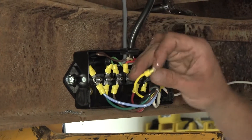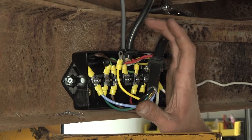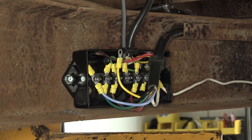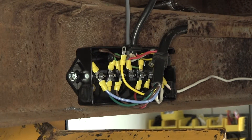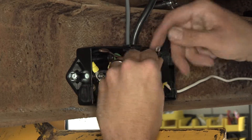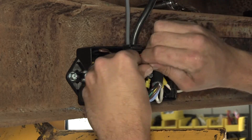The last one hanging out here is our yellow wire, which is the auxiliary power. We're not going to be using that, so we're going to tape that off so it doesn't make any kind of ground connection. We certainly don't want to power a wire around the trailer just to have it fail, so let's tape this end off really well and keep it from making contact inside that box with any of our other connectors.